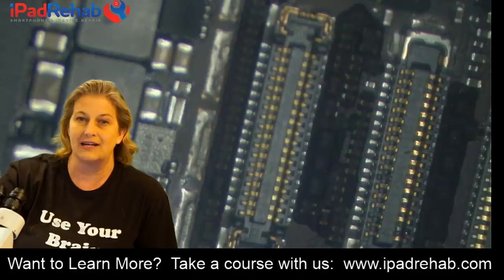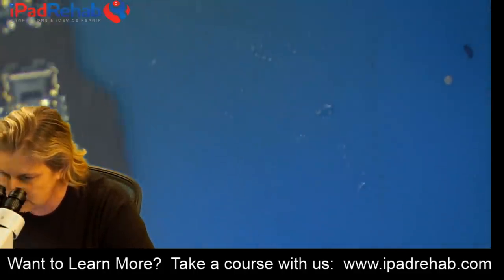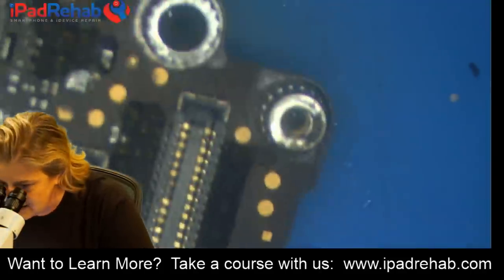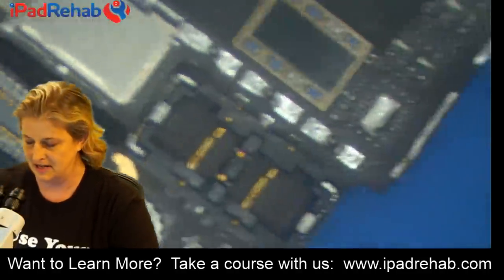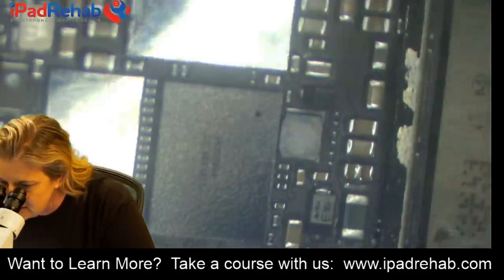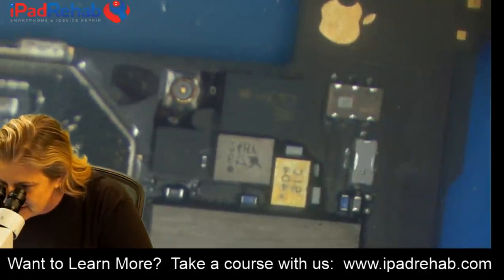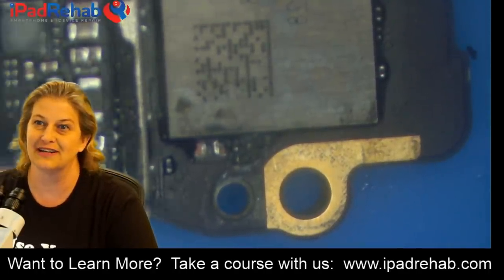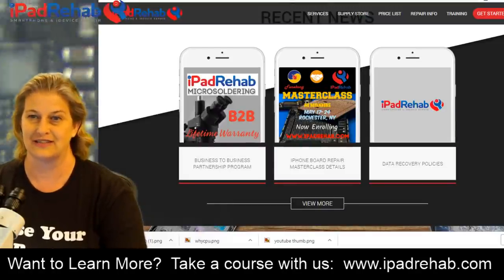This is an iPhone 6 Plus with relatively minor liquid damage. It's pretty non-remarkable - I thought it was going to be an easy case. No water in most of the hotspots in the bottom half of the phone, nothing around the back. It had the classic C5 short - a VCC main short - and I kicked off that cap. Guess what: it did not boot.